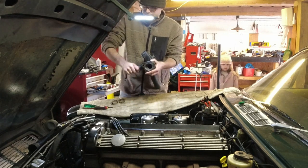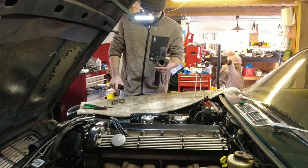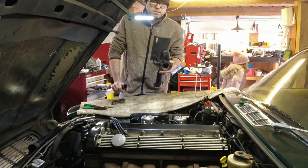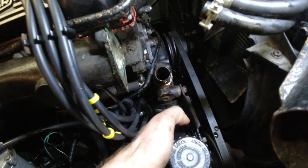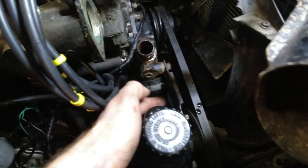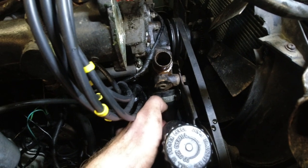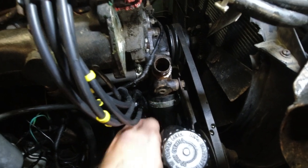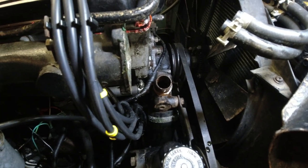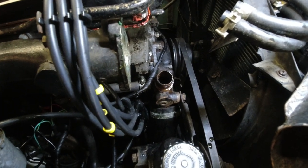But while this is off, I have excellent access to the lower radiator hose — the one from the water pump to the crossover pipe — let me show you that one, and that's being replaced as well. With that removed you can see quite good access to that hose. What happened was down there is a tensioner, and part of that was rubbing against that hose, so it did move and has cut into it. Luckily I caught that. I think that was when I was swapping out the Evans for the regular coolant — I saw that.